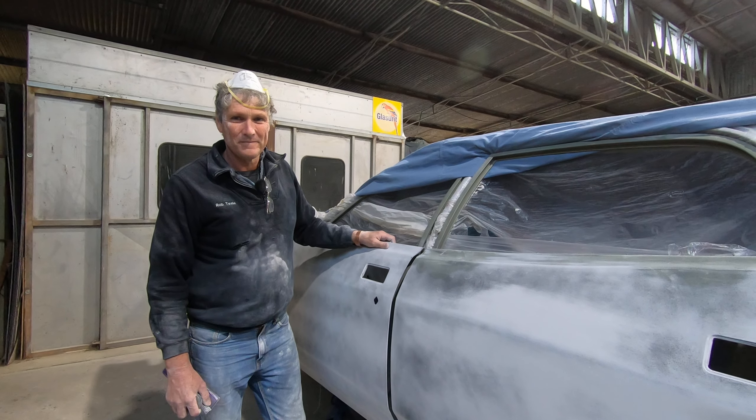These are great sanding blocks — I even use bits of heater hose for finer curls on different shaped cars. I also used the hose down in here. With my fine 80 cut from the worn-out disc, the 180 doesn't have to work so hard. This is straight off the 80 finish, and if I just get the block on it with a bit of sanding like that, I'm pulling the guide coat off — that's just how quickly it goes from 80 grit to 180. When you get to the 180 stage it just feels so smooth and nice, just begging to have colour put over it.